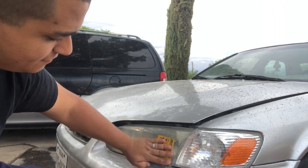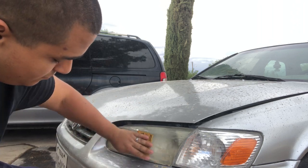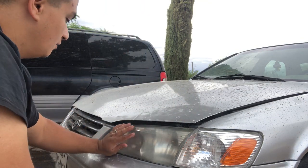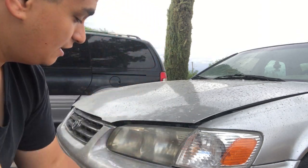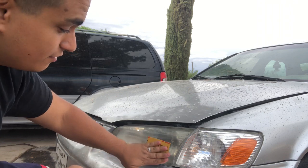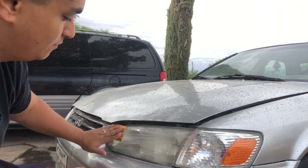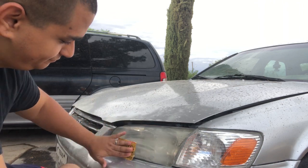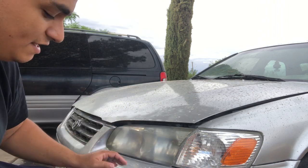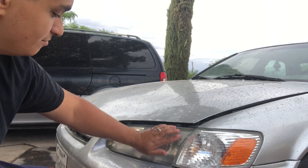With the first set of sandpaper we're going sideways — you can see all this nasty caked-on stuff. This would be much easier if you had a water bottle just to keep it moist, but I'm doing it old-fashioned, just throwing the water on there with my hands. Anytime you're doing this process on headlights, make sure the headlights are actually clean before you start sanding them down.